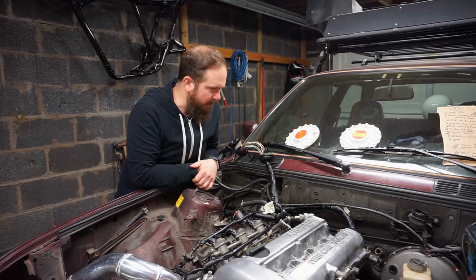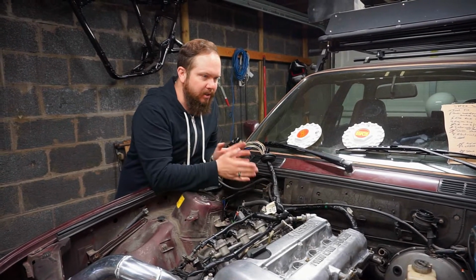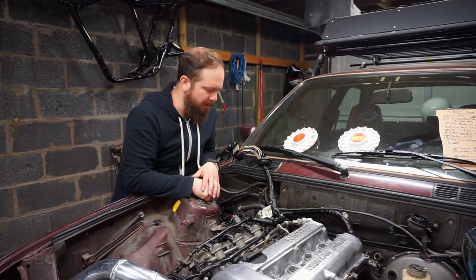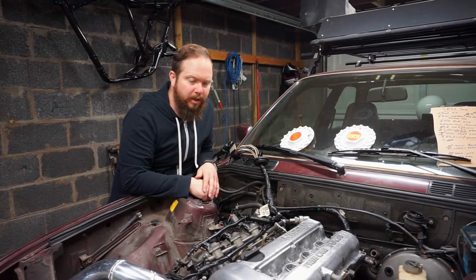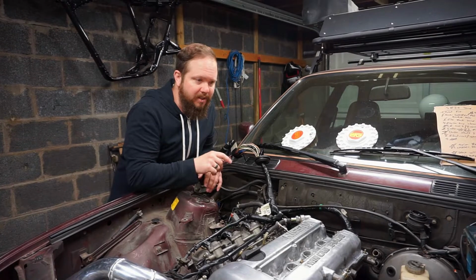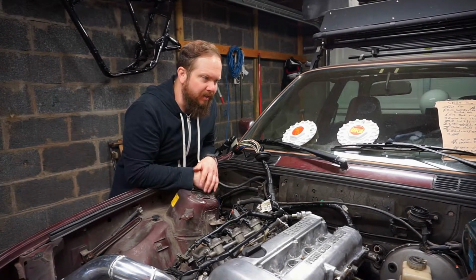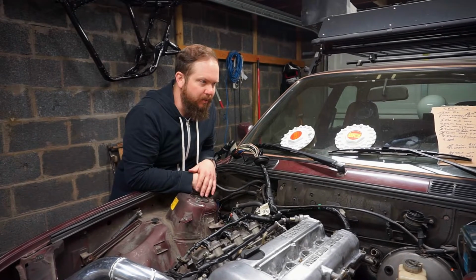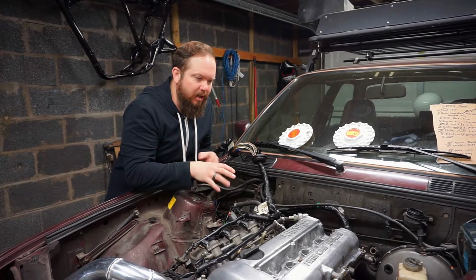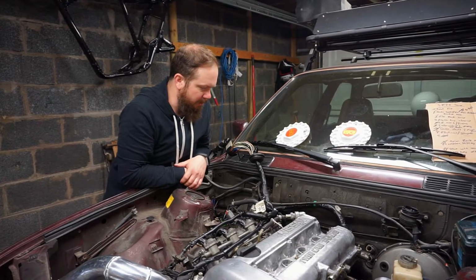All that means now is that we've got a couple of wires that we need to peel back and relocate. We've got to apply 12 volts to a couple of them, ignition 12 volts. Then we've got two or three MAF wires that we're going to have to locate, extend, and solder in a MAF plug. We haven't decided 100% how we're going to do that, if we're going to run that through the C101 plug, or if we're just going to have it in our own little loom going across the engine. So that's to be determined, but this is awesome.